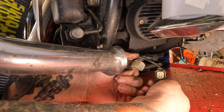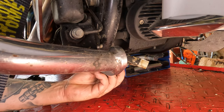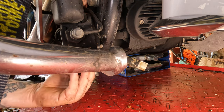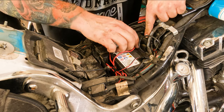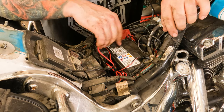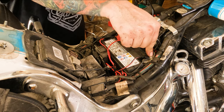There's a little thumb push-in button — push that in and pull the quick connects apart. We're going to clean this really well with contact cleaner before we put it back together. This is the wire for the O2 sensor; we're going to pull it up through and out of the way so that when we pull the head pipe off it will all come out nicely. There are a lot of little accessories attached, so we're going to have to disconnect a few things — almost all on quick connect — and we'll disconnect the negative battery terminal.